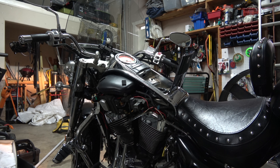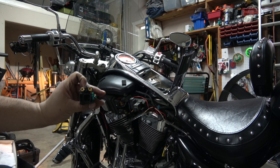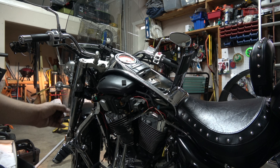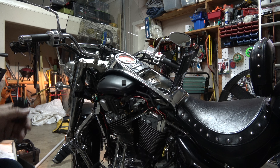I ordered through a company called Caltric off of Amazon and they have a combo starter and a starter solenoid relay. After replacing the solenoid relay — this device here which holds the main fuse — I have another video on where to locate the main fuse, it's on the front left, this is it here. After replacing the solenoid, the bike kicks on, it works great, everything's fine.